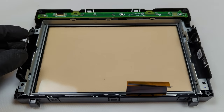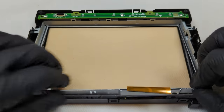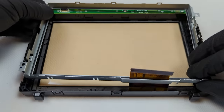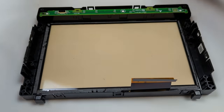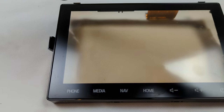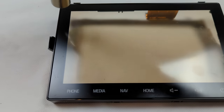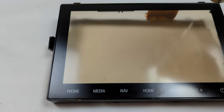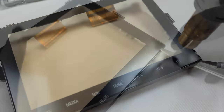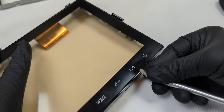The metal internal screen can now be lifted off. Heat needs to be applied again to the screen to allow it to be released. Apply good heat and pry up at one corner. Use a sharp tool and then a plastic tool to work the way around the screen and release it from the housing. The housing is made of plastic, so take care not to mark the surface.